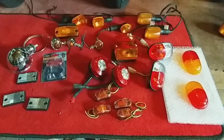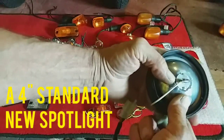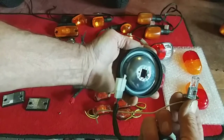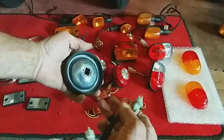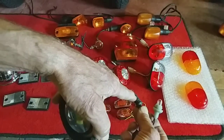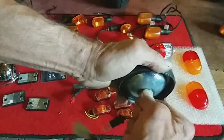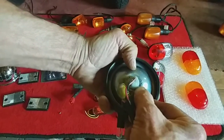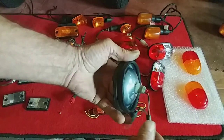Let's talk about front lights. This is one of those 4-inch spotlights - I've just took the inside out to show you what's going on and what you need to do. There's a little screw inside that holds this bit fitting on. You take this out and discard it because you don't need it anymore. This bulb is off of a mobility scooter. There are two types: lights and indicators. A lot of the time I'm fitting these in, but on this occasion they just fit in there - you wobble it round and it fits in a treat. There's a little tag on there that I'm cutting out so it goes flatter. That solves the problem of your front light with the spotlight type.